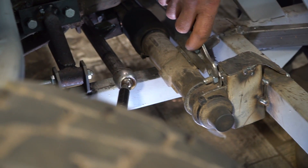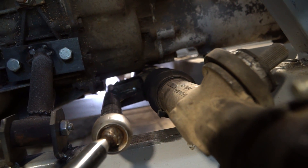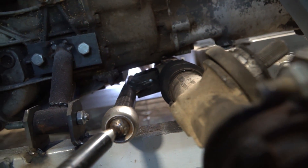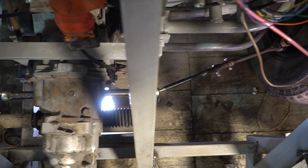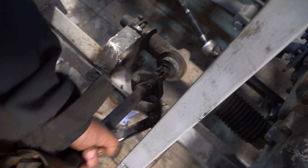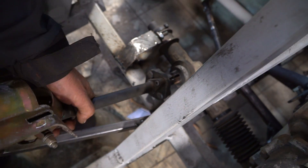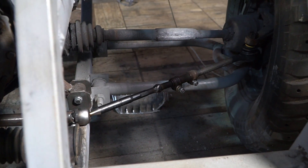So I'll have to put in a steering rack. I completely forgot about it and there was no place for it. I had to put it in the wrong position — a very large angle won't let it work correctly, and during suspension movement the wheels will steer themselves. I'll need to come up with something in the future.